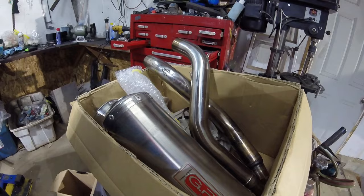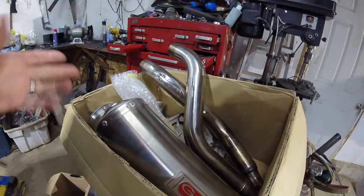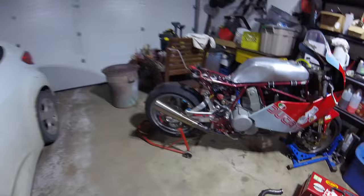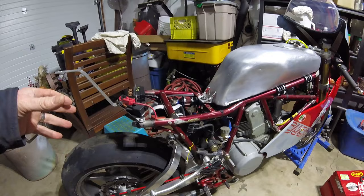They're not in beautiful shape, but they're nice and high-mount, get things out of the way, and actually fit nice and tight to the rear swingarm so you're not grinding down the edges of the collectors, as Supersport Ducatis are often prone to. But they actually sat up almost too high and too far back on the frame, so the muffler was starting to sit right up here.